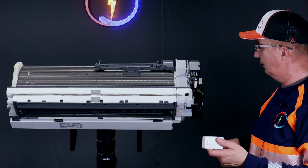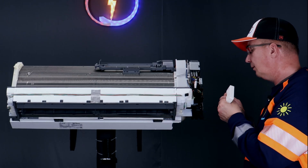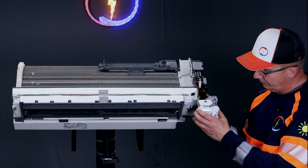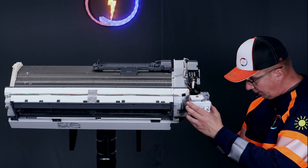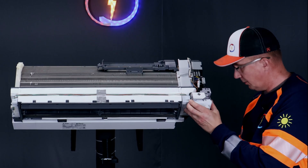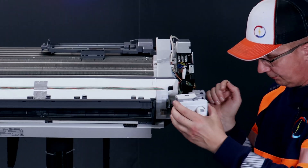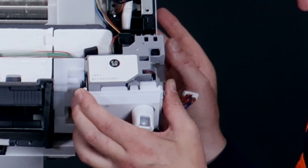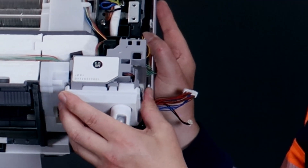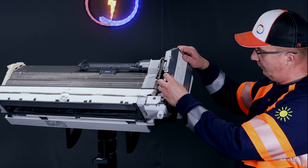You can put this Wi-Fi router back on starting from the circuit point. Then put the sensor package on — first hook the upper end. There are claws on the upper end; put them in like this and it will hook on the top. Then the bottom end will clip when you just press it on. Next we can put this cover on.